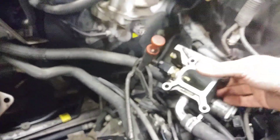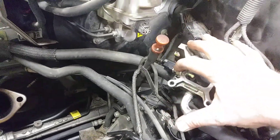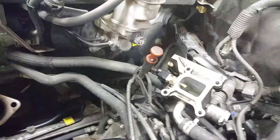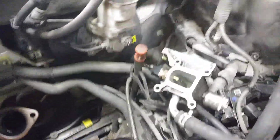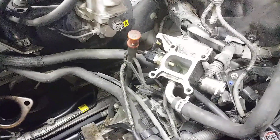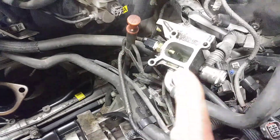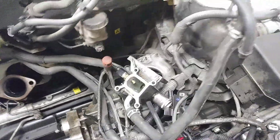One thing you have to do when you do a swap on a Mazda 3 or Mazda 6 with these Fusion engines is this block in the back doesn't have the coolant temp sensor here. The temp sensor on the Fusion engines is up between the number two and number three cylinder in the head. So you have to swap that out — I just basically unbolted it from back there because I'm going to have to use it anyway.